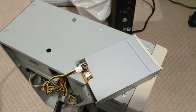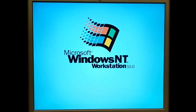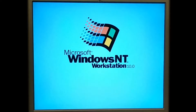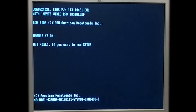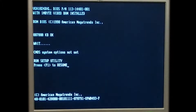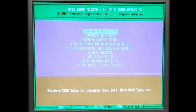Plugged in the floppy drive, so if it posts I can try booting MS-DOS. Here goes nothing — as in literally nothing, because the power supply is probably dead. Whoa, okay, so I bumped the power switch and it came to life, so let's try it again. What do we have? We have a ROM BIOS at some point. Keyboard error — yeah, because I don't have a keyboard plugged in. It looks like we got eight megabytes of RAM. It has a working beeper!